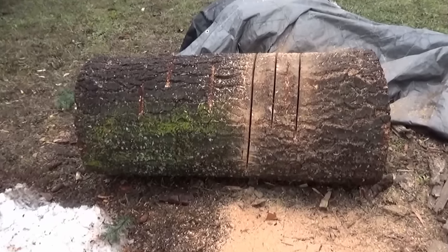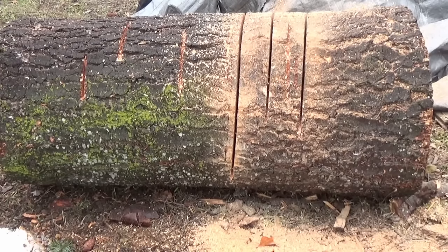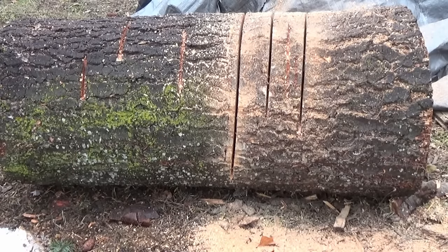We can see what's going on, everything's curving to the left. Is it the bar or is it the chain? Let's take a close look at each and find out. You can see how it was holding up. I can see this far left cut almost looks wavy, but it did favor an angle to the left. I was doing my best to keep it straight, but it didn't want to stay straight. It wanted to be the San Francisco chainsaw. So let's see if we can revert it back to the Great Northwest.